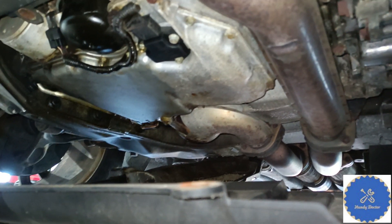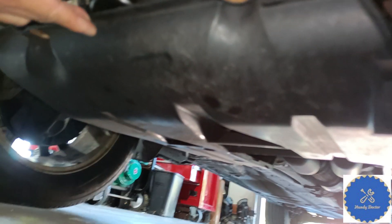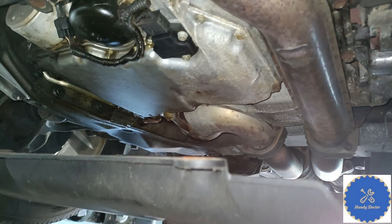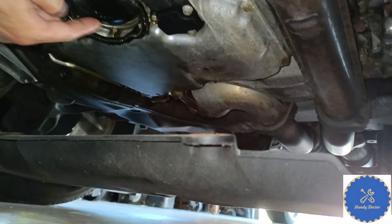The oil filter is located right on top of the front edge of the skid plate. If I can remove a few screws — there is one here, another one out there, and there might be one out here but it's missing — the oil filter becomes accessible. So the answer is yes: when I remove three or maybe four screws, the skid plate drops down. The screws are 10 millimeters. Very easy. And here is the oil filter.